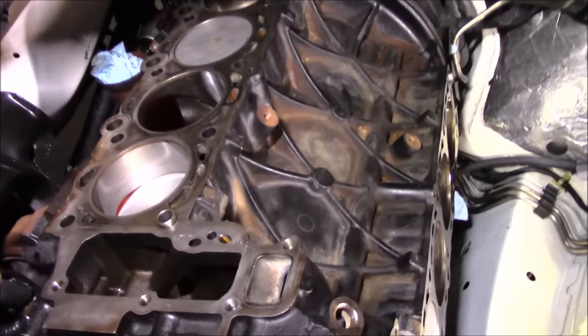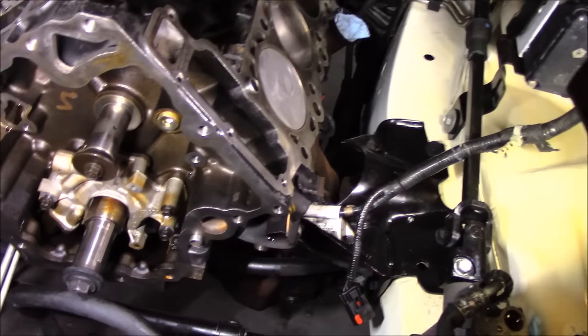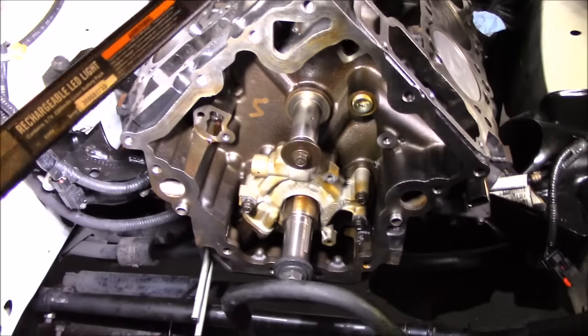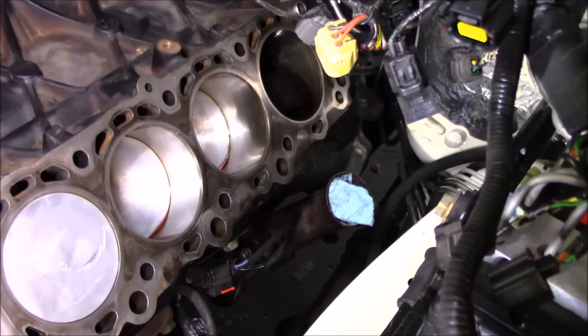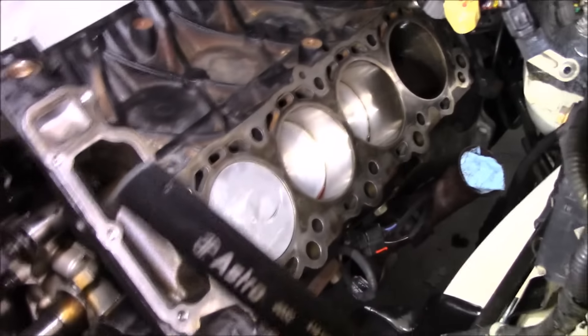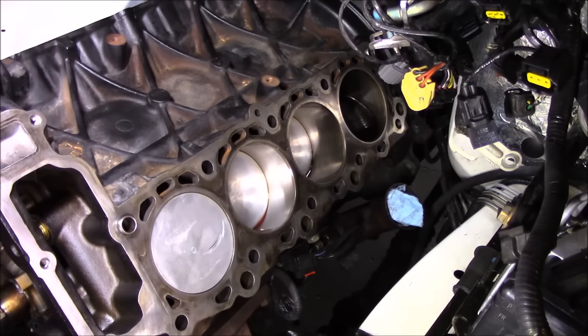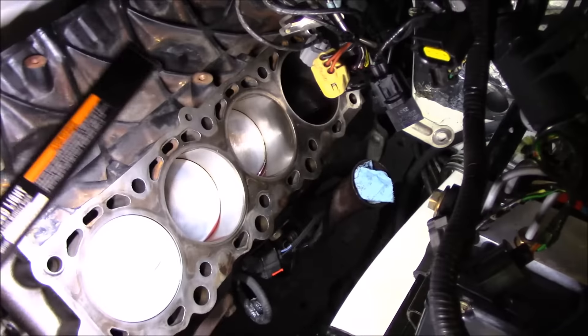Both sides we got the pistons cleaned off, the cylinder walls cleaned out, the inside of the timing cover cleaned out, and the gasket sealing surfaces cleaned off. This is a cast iron block with a sheet metal gasket, so it's pretty easy to get this surface cleaned up — no composite material left behind. I just took a brass wire brush on my DeWalt and ran it in and knocked off any little RTV that was on around the timing cover and coolant ports.